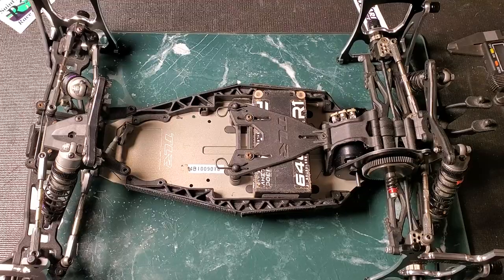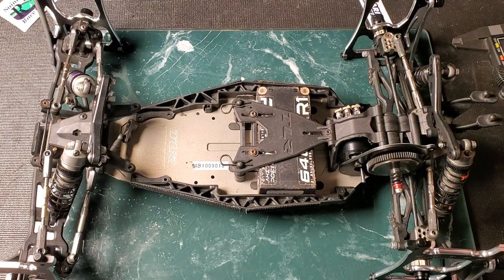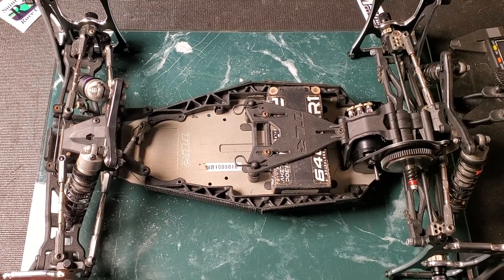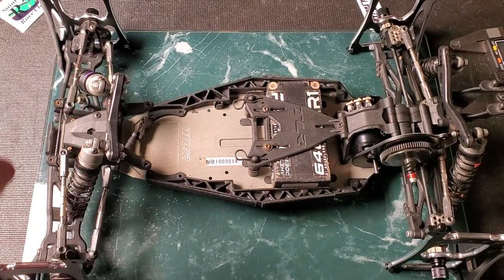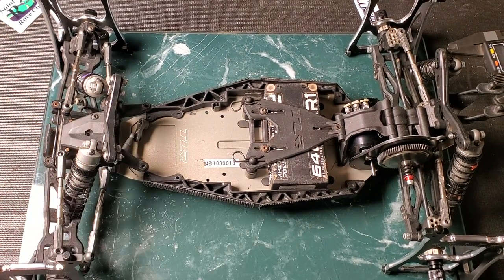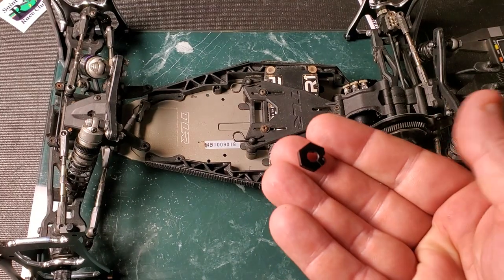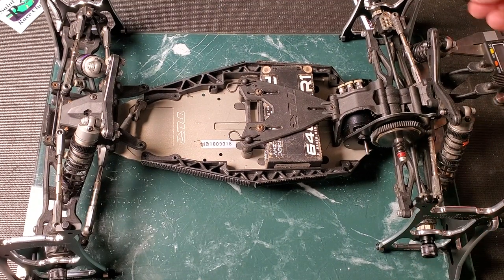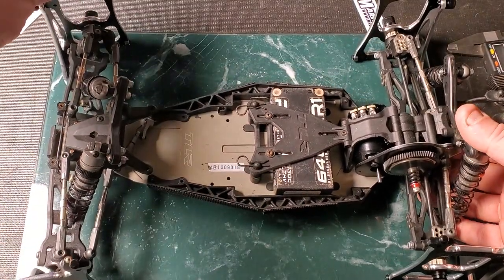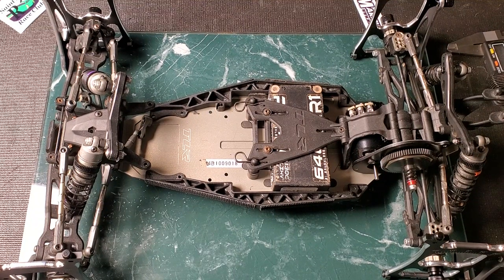So with that, we have the SkyRC setup system for off-road buggies. I should mention that this will fit basically any off-road RC car that has 5mm axles. I've tested it on my 22 two-wheel drive buggy, my 22X4 four-wheel drive buggy, and my stadium truck. With my stadium truck — which has quite a bit longer rear axle — I used an additional hex as a spacer of about 4mm and added another hex on the outside with the washer to take up the extra room. So it can be made to work for any RC car with a 5mm axle, and I'm quite sure I could use it on my Losi short course truck as well.